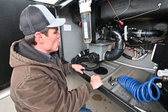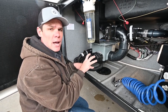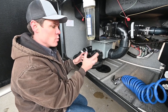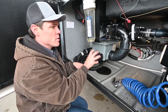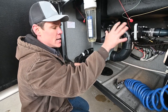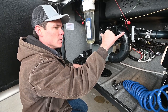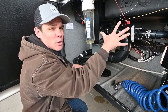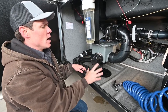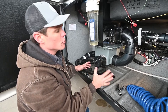If you didn't want to utilize the macerator, you could hook up a traditional gravity sewage hose to this outlet right here. Just make sure you hook the hose up before you open either of these valves. You don't ever want to open this cap with either valve open — they need to remain closed until you've got the cap open and the sewer hose installed. Going that way, you could dump the waste system through the traditional gravity manner.